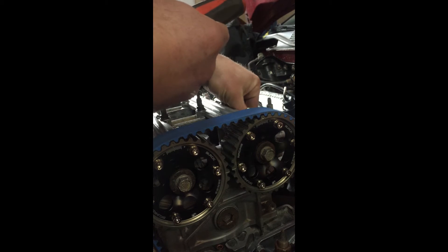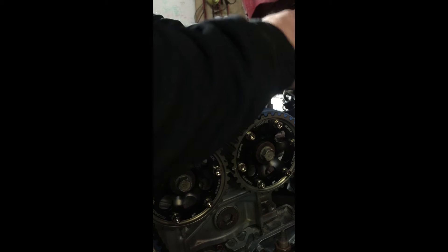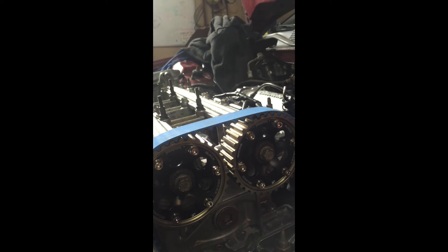We'll do the other side. Making funny faces because it's awkward. B-series cars here, a pain in the butt. There's our six, our intake side. I'm going to go ahead and do the exhaust side as well. I'm going to grab my eight. Stick it in there. I'll turn my flathead enough so that I should be able to easily work my feeler gauge in there. There we go. Turn it back until it stops, then back a little more. Just a little bit of drag here.